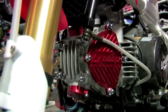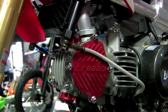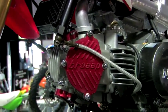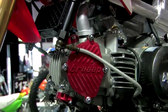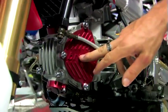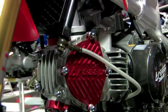The 150cc Braapster Maestro comes with a KLX style head, and there are so many hot-ups available for this engine. The 2010 model is absolutely sick — we've played with the gearbox spacings to make it last longer and adjusted the kickstarter shaft to make it stronger. We have so many kick-ass hot-ups available, including a CNC engine dress-up kit, oil cooler, 4-up gearbox, and 4-speed manual.